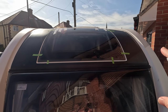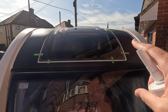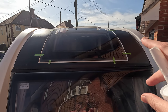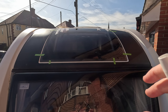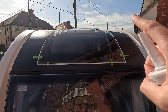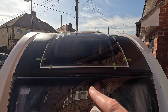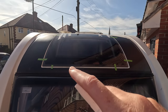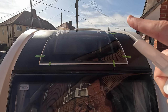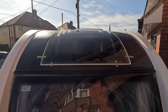But the way we did this was, had a friend on another ladder, so we're either side of the caravan, and then we just lifted the window into place. Because the silicone is slightly higher than the foam, you're able to get it roughly in place, move it slightly before pushing it right down. But once you've got it in place, obviously you will need to tack it at the top so it doesn't move. And also you'll need somebody on the inside pushing up whilst you're pushing down. So again, you get this window in place where it needs to be, as well as down the bottom. And also, once you think you've got it in place, just double check the inside, the gaps that are aligned